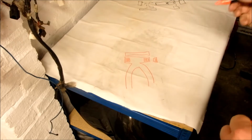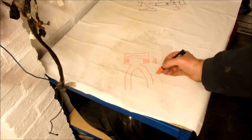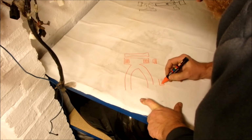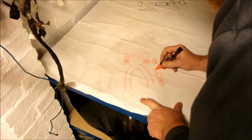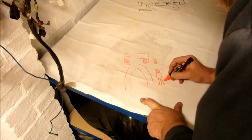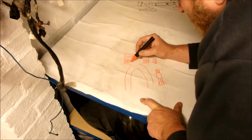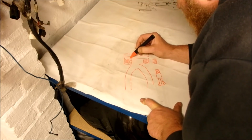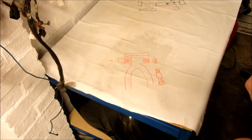So what we are going to do today is use a blind hole bearing puller. If I can get a piece of paper you can see what I'm drawing. The blind hole bearing puller has a shaft, it's got a lip, through the middle it's got a screw thread, and then it's got a bolt, and then a secondary bolt. You tighten this bolt here, it lowers down, and it splays these edges further out. The aim is to come in until these are splayed fully, like so, and then you're able to pull that way, thus pulling the bearing out.